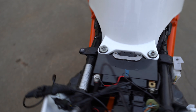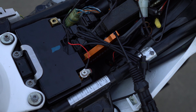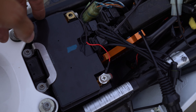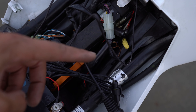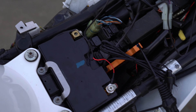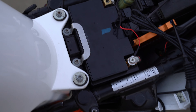Run your wiring harness, connect everything up, and route it to the back. This is how I have my module — I set it right back here with some velcro on the bottom to help with vibrations. Then run power. I connected mine to the battery terminals, but the instructions say you can also connect the positive lead to the fuse area or somewhere like your tail light circuit so the module isn't on 24/7. I'm not that experienced with electrics so I went with the battery route.